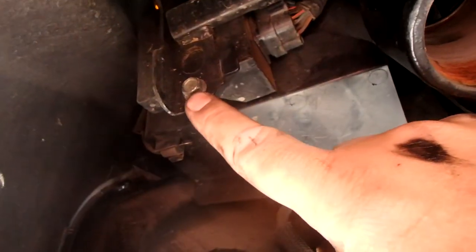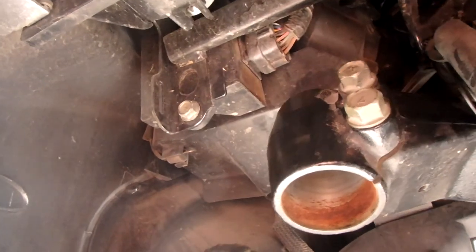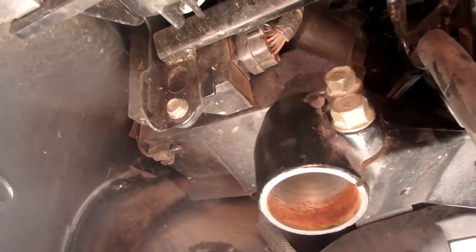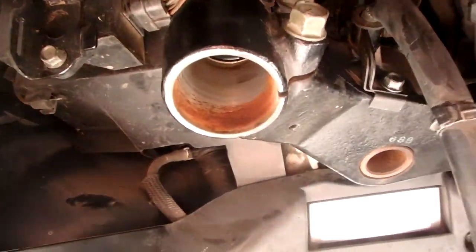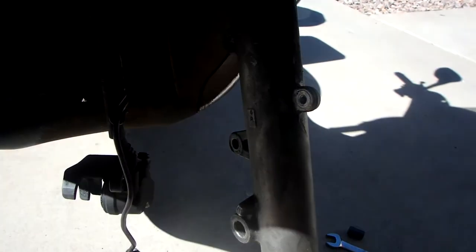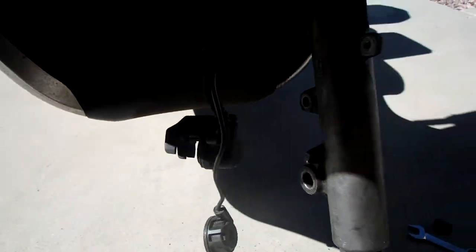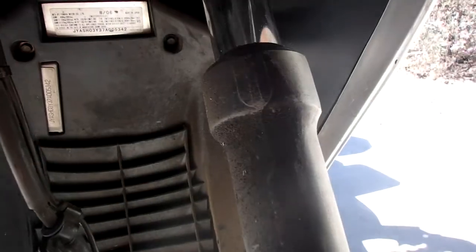So you have a bracket right here, and then I put the wrench on. Then I slowly moved it over, so I didn't have to get my hands up in there too much, and just broke it free. Then I did the rest by hand, and the whole fork came out. I'm assuming that you've got the fender off, which is four bolts, and the brake, which is again four bolts, but I will show you putting that back on in reverse, because it's easy.